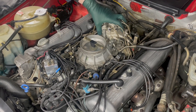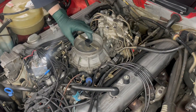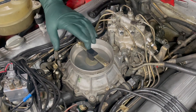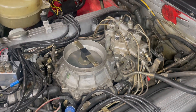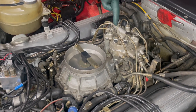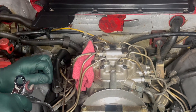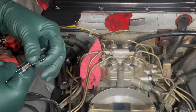You're going to have fuel spraying all over the place if there's pressure. One of the quick ways to determine if you do have pressure in the system is to push down on this plate right here and you'll actually feel back pressure. You may even get a little squeaking noise, but this engine has sat overnight. I'm pushing down and I'm not getting any back pressure, so there's probably very little fuel pressure. Even then, I'm going to take a precaution when I disconnect this fitting right here.